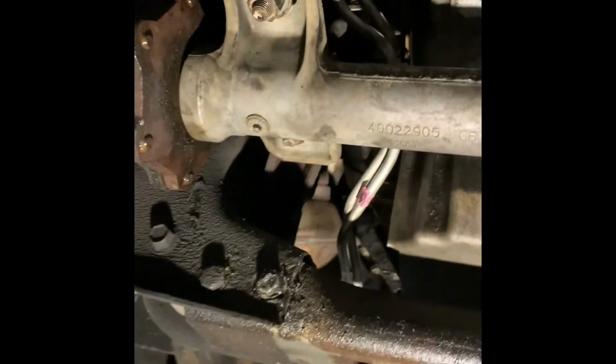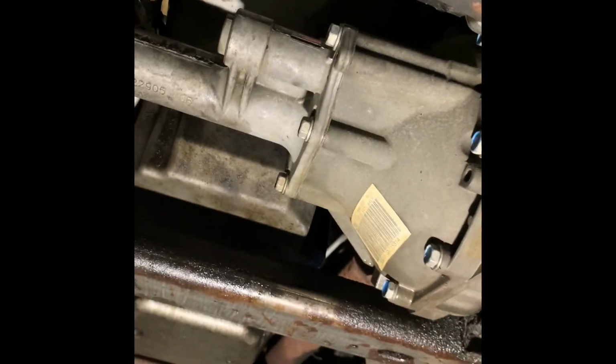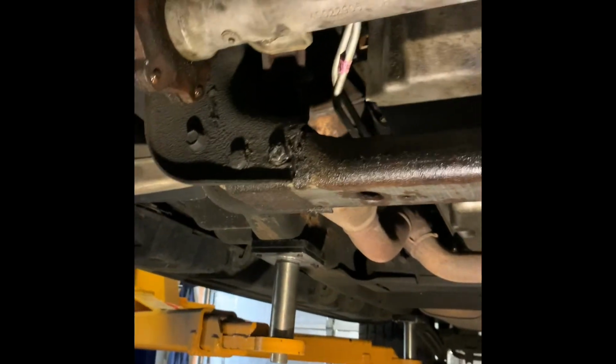Anytime you're dealing with your axle bolts or anything, make sure to throw some thread locker on it. But as you can see, it's pretty much straightforward. There's really no major trick to it. I would say with doing the new cooler lines and everything, I got probably 2 hours in it, roughly. That's with pressure washing the front diff and oil pan, of course. I forgot to pressure wash my slimy cross brace, but I can get that at least with a car wash. That pretty much wraps it up.